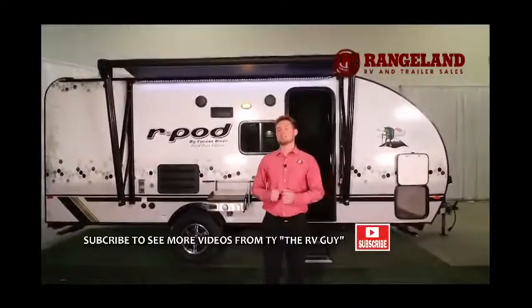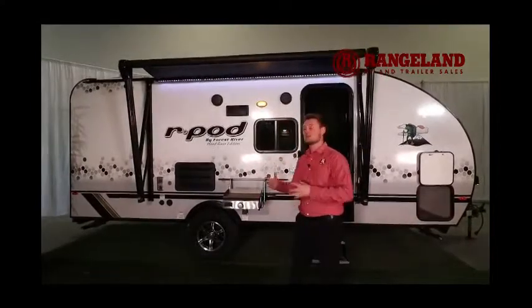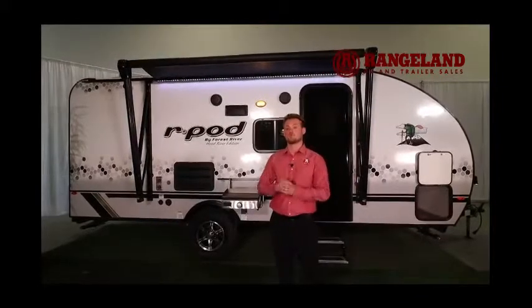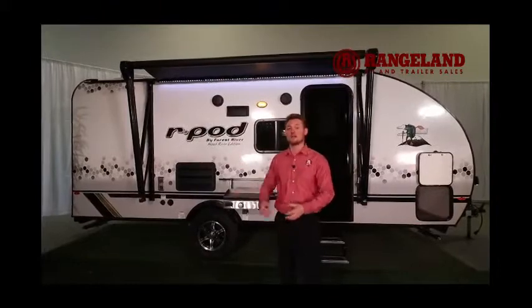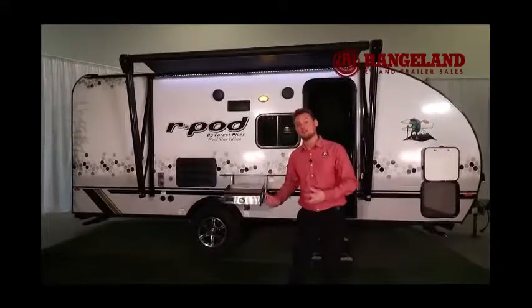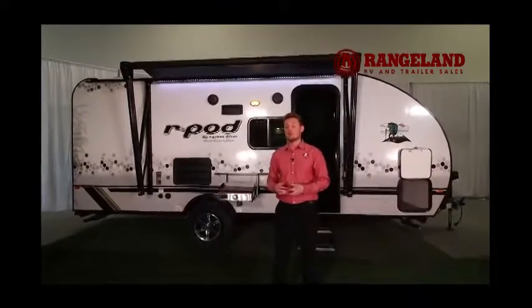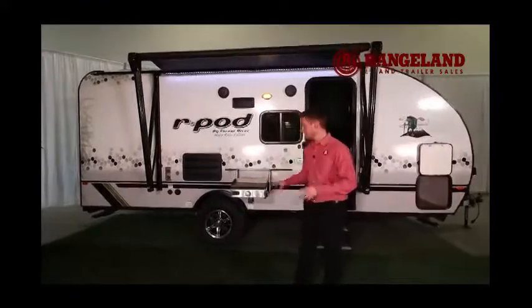So one of the big things that we love to talk to our customers about with Rpod is the style of construction that you get out of the brand. So what we have here is a complete aluminum framing and block foam insulation, which is called a pinch roll product. So this is awesome because it's a solid wall throughout on both sides and even into the back. They also do that aluminum framing into the roof and into the floor, and they even add that vacuum bonding, or sorry, the pinch rolling into the flooring there with the insulation, so it's a lot lighter, but it also keeps the floors warm.